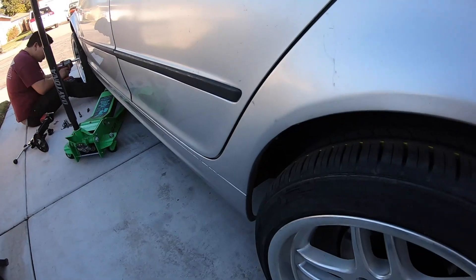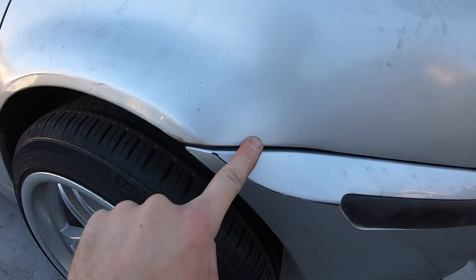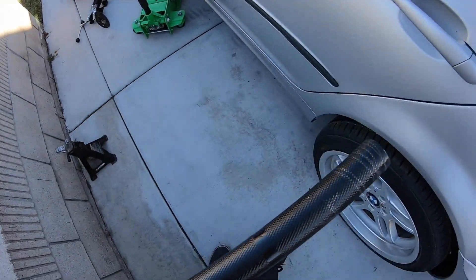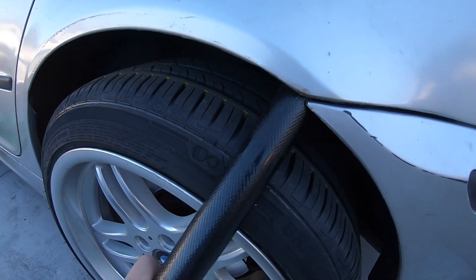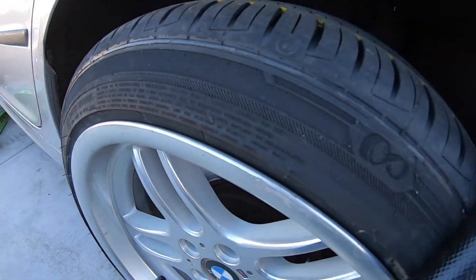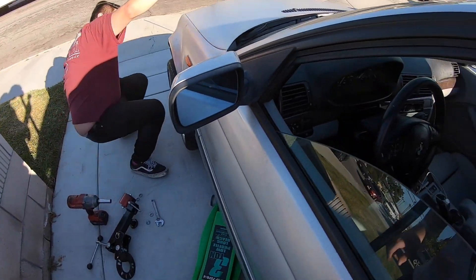The car is back from the test drive. It did good, but it was rubbing a little bit right here. We noticed it's the bumper - I think I tightened it too much. What we did to offset that was we pulled this piece out a little bit and pulled just a tiny little pull to kind of even out both sides of the quarter panel - and we did that with jack handles. We put it here, lowered the car just a tiny bit, and kind of rolled it along and did a little pull right here just to pull this out a little bit, because we could tell it was rubbing a lot right there. Sometimes you got to do what you got to do. My boy Chris rolled that side a little bit more than this side, and that side was perfect. So I asked him to even it out and he said yes.